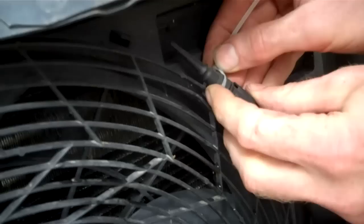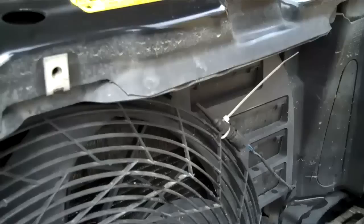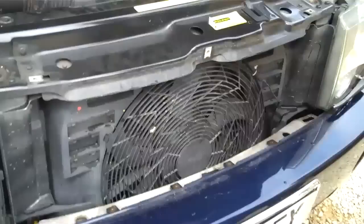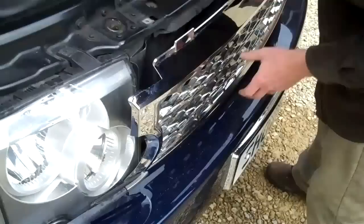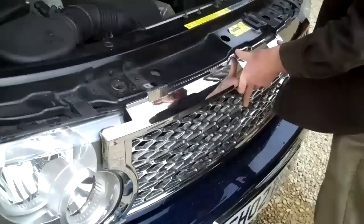Just on the side — like that. Cut off the excess. Then locate the three bottom fixing pins into the slots in the bottom. Move the wipers out of the way, go in there, line them all up, and press that in.